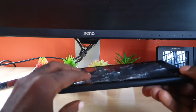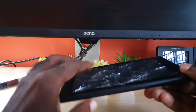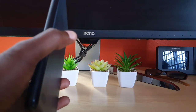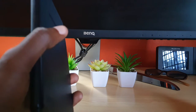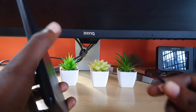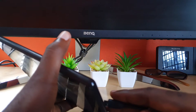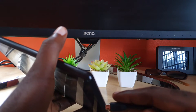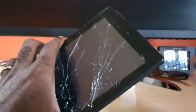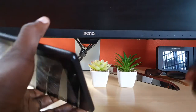This device is okay — I'm simply showing you the general troubleshooting tips we run through with tablets to get them back up. So the first thing: if your device is not powering up, maybe the charge has gone down to the point where there is no charge. Go ahead and get your charger, connect it to the device, and leave it for about 30 minutes. If you don't have much time, leave it for 15 minutes, then press the power button and see if the device starts up.